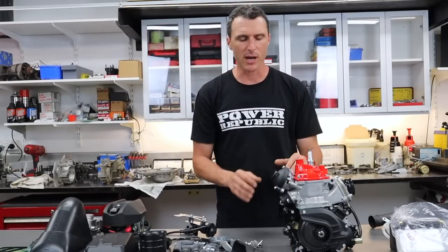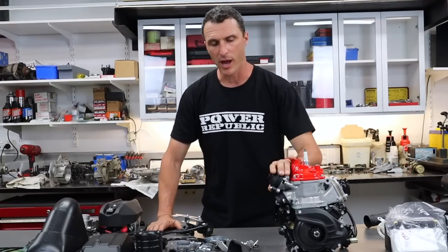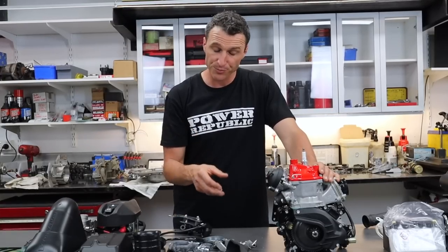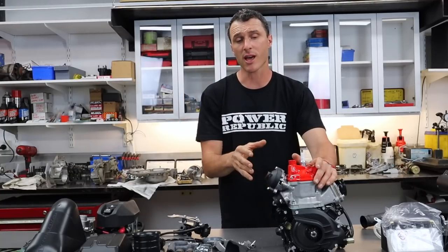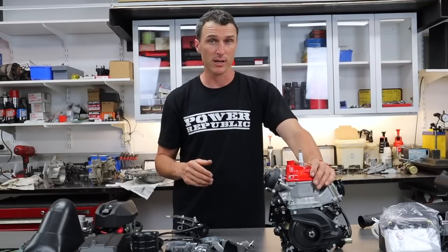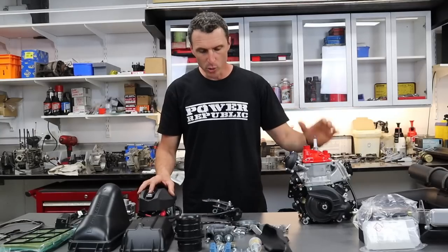The EVO power valve is one of my favorite things about these engines. Previously the Achilles heel was the bottom RPM range of 6,500 to 7,500 — jetting, age of bellows, gear ratio, and throttle position all affected how quickly the power valve would operate. Now these things are magic — the new electro-pneumatic control is excellent. They stay closed until 7,500 RPM, then snap straight open. You can see that on the dyno through this little window — the power valves opening at 7,500 is a really great feature of this 125 engine.